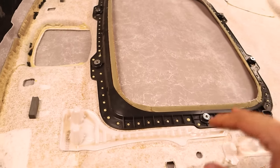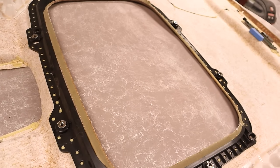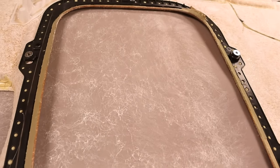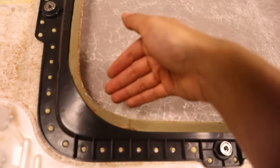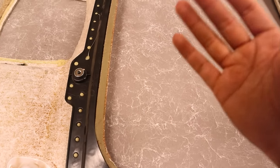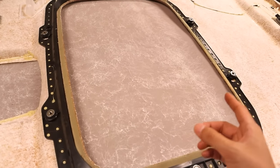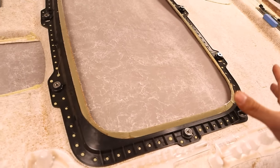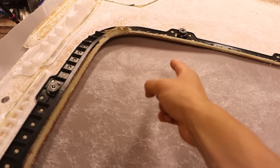The proper way to cut the edges is to take a knife and finesse along the line — I'm just going to cut close to the line and flip it over to tuck everything away. Now that we've got it flipped over, we're starting with the sunroof section. We'll cut out a big hole first to make it easier, then do triangles at the corners and a rectangle in the middle. You're basically giving yourself enough fabric to fold it over so it'll be very tight. Put a ton of glue on the area, press it down, and it should be good to go.